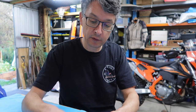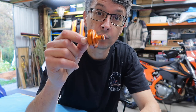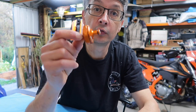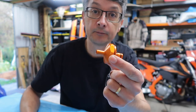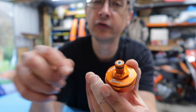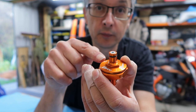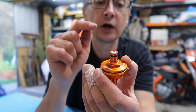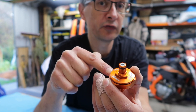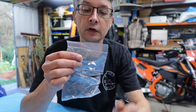The unit itself is a really nicely machined piece. One side connects to the quick disconnect fitting on the fuel line already, which makes it really simple, and the other end the fuel hose attaches to. You'll notice inside the end of it is the standard little witch's hat fuel filter — I'll remove that because I don't see the point in having two filters. But it's good to know it's still there; if the main one is damaged you can simply swap back to that quickly.